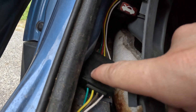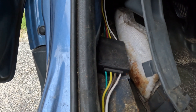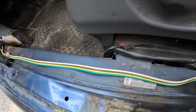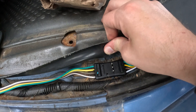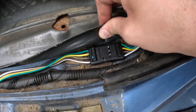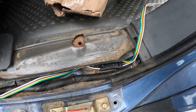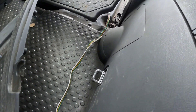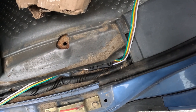I plugged in the CURT controller and mounted it here, just free-floating. It doesn't really jostle around or anything because it's pretty snug inside there with the foam. Then I ran the cable down the side. We have an extension right here — the extension I got from Harbor Freight, so it's pretty inexpensive. The CURT comes down to here and then we just extend it from there. You can probably go into this area to hide the cables better, but I just went around into the wheel well area.